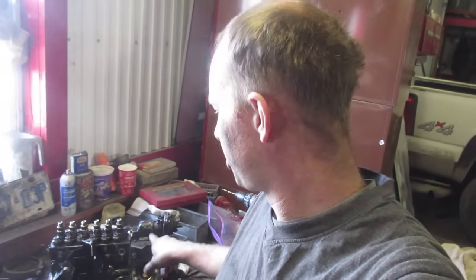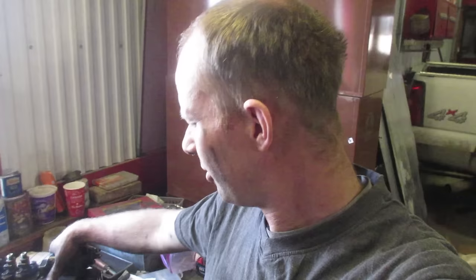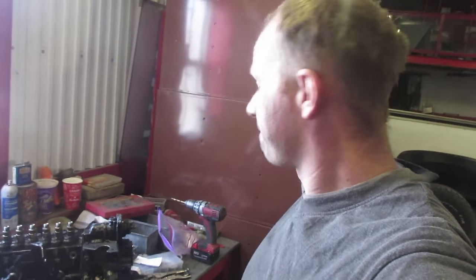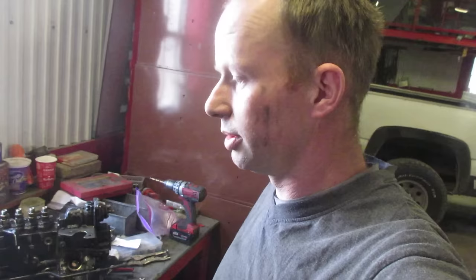I did put a number 8 fuel plate in here while the battery was charging. We're going to throw this pump back in - I need it for tonight. I put a little bit more tension against the spring so we get more fuel as we're coming into boost - we just want a little puff of smoke as we're coming out. No rolling coal because that's just stupid.